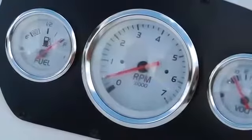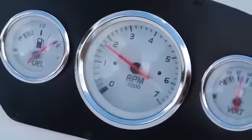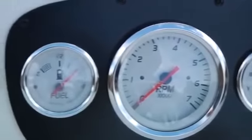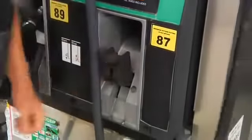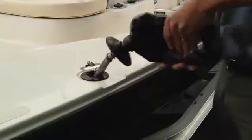Alright Skipper, good job. As the pilots say, make sure everything is in the green — meaning check your gauges for the proper operating range. The amp meter or volt meter should show a positive charge. The water temperature gauge, if you have one, should be in the suggested operating range. And check the fuel gauge. We took care of this on the way to the ramp, but it never hurts to double check. Make sure you have plenty of fuel for the activities you have planned.